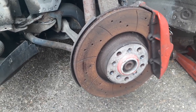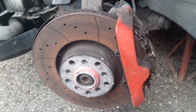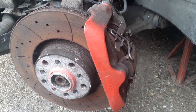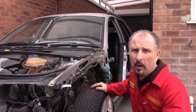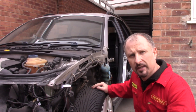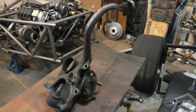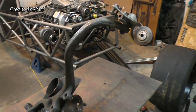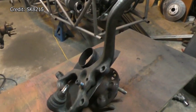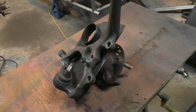Because the hub was no good, sadly this meant I couldn't use those big brakes either. So cutting and welding the hub carriers was off the table for me. But here's someone who did it with some Mercedes hub carriers — this is a spindle from the E55, the one I'm planning to use for this car. But in order to use it I'm going to have to change the location of all these ball joints and basically do a lot of cutting and welding on this.